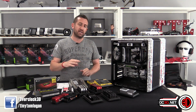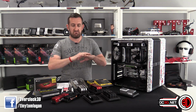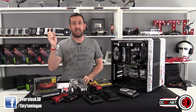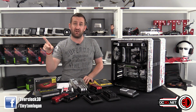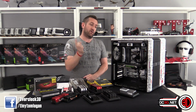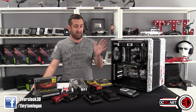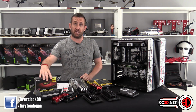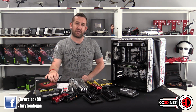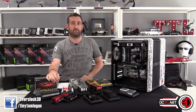Went into the overclock with the 2800 megahertz. We've got 2400 megahertz running. Lovely, not a problem. That was quite literally XMP, and then I put 44 in on the multiplier ratio. I put the voltage in, bosh. Pretty simple, lovely. When I put the 3200 megahertz in, it actually got a bit flaky. 3200 megahertz at XMP, with stock CPU, it had got warm.